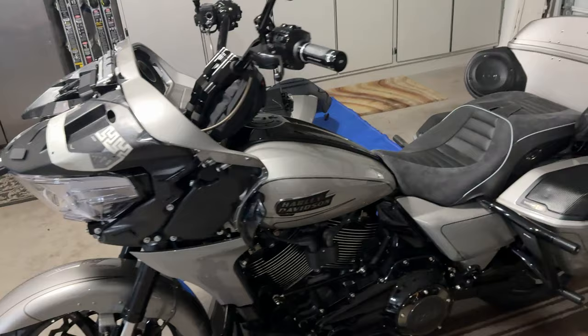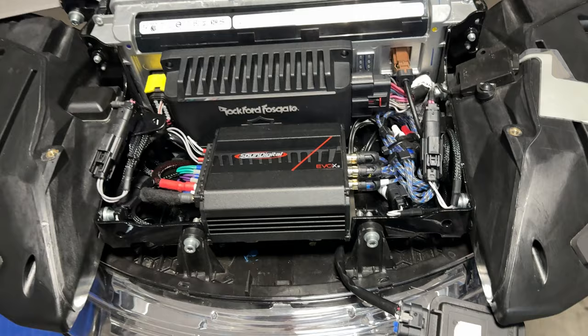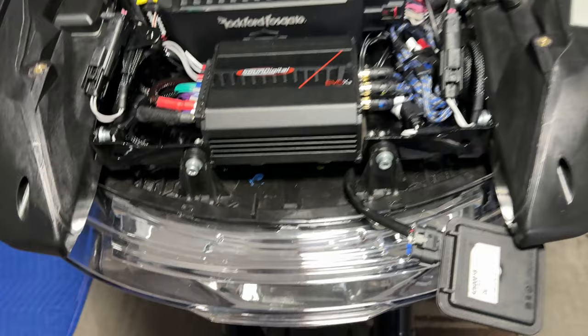Good morning. I've had a lot of questions on my videos for the audio upgrade, and I wanted to talk specifically about the audio upgrade. Carlos at NVS Audio designed this system to go after the factory amplifier so you can still use your radio. It basically takes signal before it goes to the speakers, reprocesses it, sends it back through the amp, and then pushes it back out to the speakers — so you're actually amplifying the Rockford audio signal.